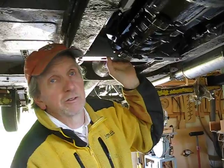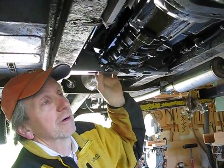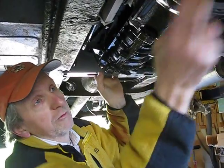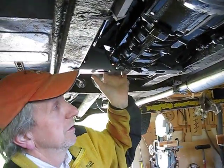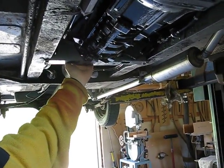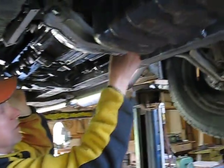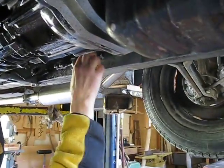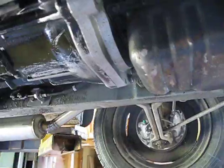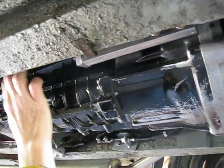The clutch is from a Tercel, and there are a bunch of different parts in there that we had to figure out — getting everything lined up is quite a process. How many gears do we have now? It's a regular five-speed, with fifth being probably an overdrive. And it's geared right now — the clutch is cable-activated. We had to make all that stuff, but it all seems to be working pretty good.